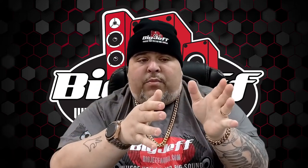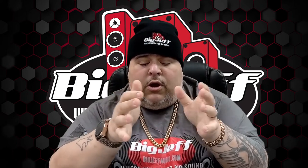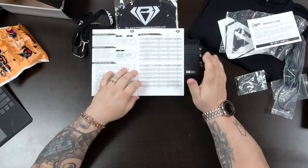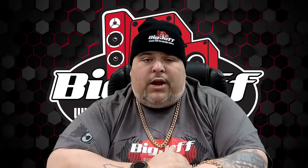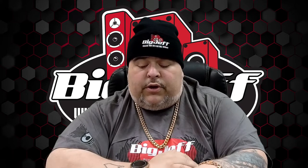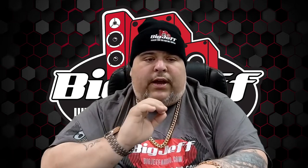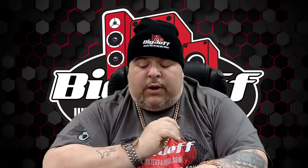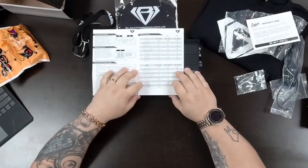They recommend no lower than 0.2 volts and you can go up to 5 volts, so if you have a good aftermarket radio at 4 or 5 volts, great. If you're using a high-to-low adapter, make sure you check that. The crossover range starts at 50 Hz — most people are not going to set their sub amplifier that low. The average is usually around 80 Hz; some people go a little higher if they want more upper sub-bass. I would recommend setting it at about 80 Hz.